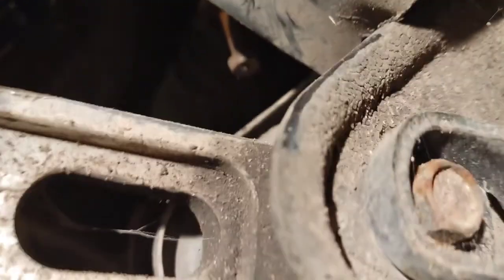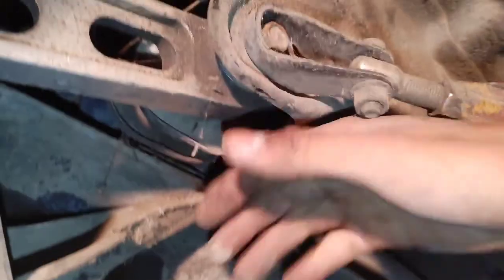So it's hanging down. I undid the top. Now with the side, here are the ones I was telling you about. So I got this clamp done. We should be able to pop it that way. I got this clamp moved over. So I broke this loose, so we should be able to pry this down, get this gas tank out, drop it down, pull it out. I got those hoses loose, so I'm just gonna grab this. Boom! Look at that. Simple.